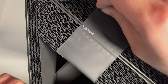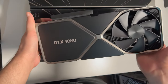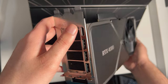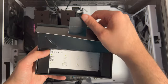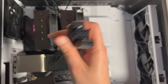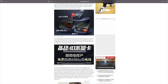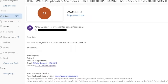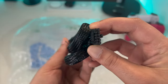With just one last thing left — the graphics card. The size on this thing, it looks beautiful. The size and fan size are the same as the 4090, which will help keep the 4080 that little bit cooler when pushing the graphics to the max. Here's the 16-pin to 3x8-pin PCIe adapter. Before I bought the Thor P2, Asus announced they would ship native PCIe Gen 5 16-pin cables in their Thor P2 lineup, so my understanding was it would be included. However, it was just the 12-pin that was included, which obviously won't work with the 4080 — though it is included with the 1200W version. I reached out to Asus support and they shipped me the 16-pin within 3 days. Shout out to Asus — their customer support is just amazing and quick. So if you haven't done that already, that's what you need to do.